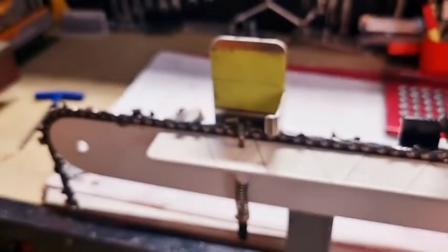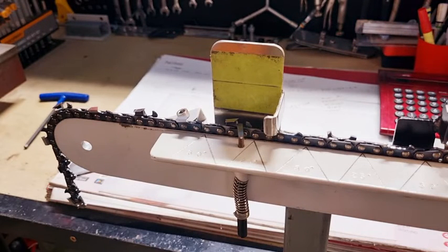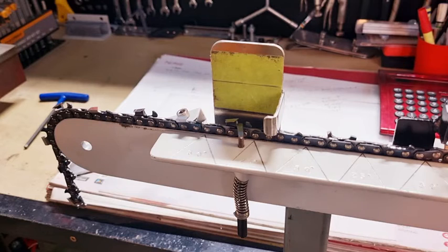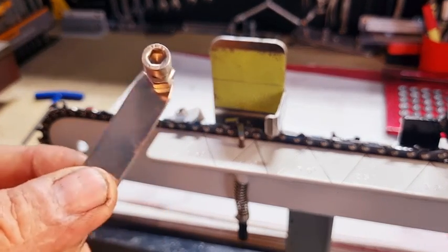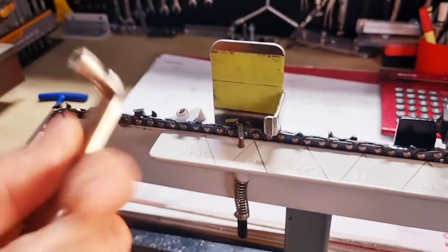Highly recommended to get 100% chainsaw efficiency, because the attack angle of the tooth needs to be around a minimum of 5. Ideal is about 6.3, and you will never achieve that using those little flat gauges, which are a constant depth gauge. Do yourself a favour, buy yourself a progressive depth gauge. Can't get your hands on one, use the feeler gauge method. If that fails and you don't like the idea of doing that, do yourself a favour, get someone to make one of these for you, or make it yourself. It's pretty simple.